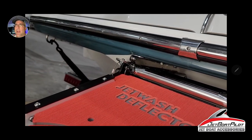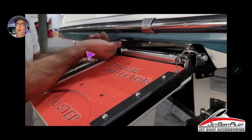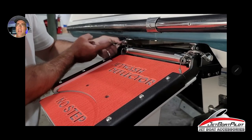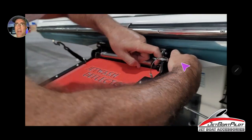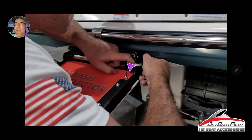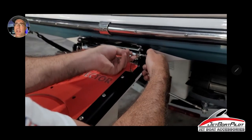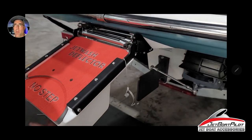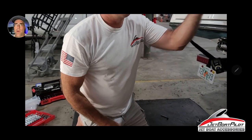Ready to go surfing. When you want to take it off, grab the pin and pull away while at the same time pulling tension on the locking clevis itself — then pull the pin out. Same on the opposite side — pull away while pulling pressure against the locking clevis. It's intentionally made difficult to get on and off because we want it to stay on and not unlock itself. Slide the part out and store it in whatever storage compartment you like.